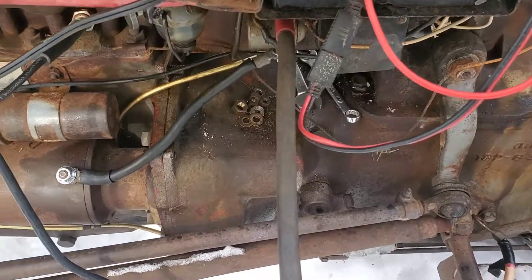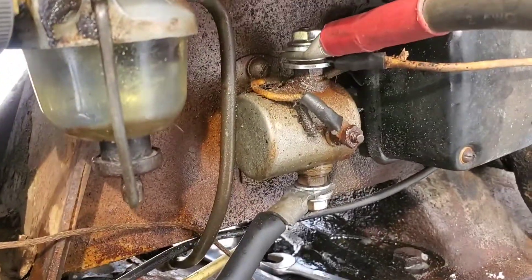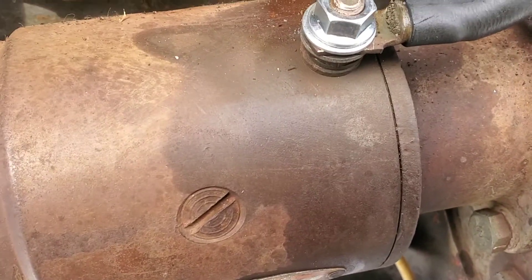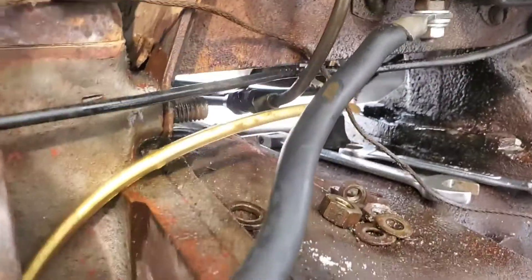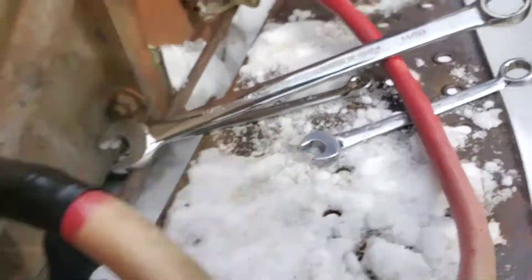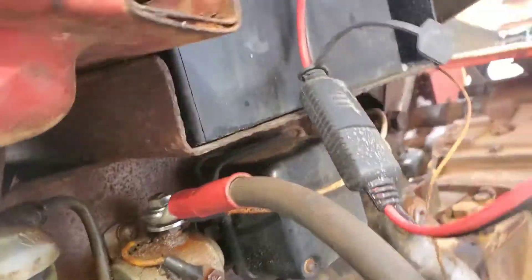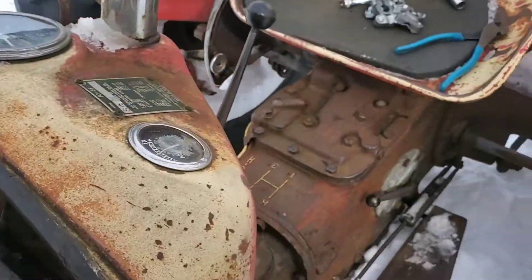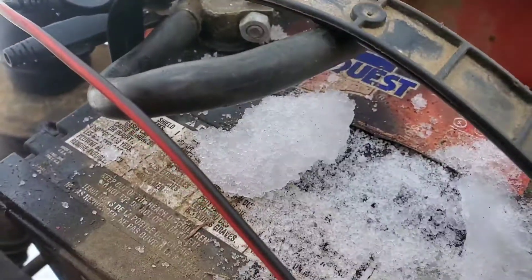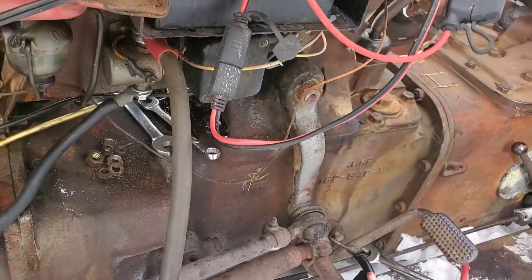All right, friends. So I took everything apart using whatever was still there and tried to put it all back together again, and it just turned into complete junk. So what I had to do was root through all my stuff and try to find some flat washers and some nuts. This cable is complete junk - green on both ends. So I'm making up a new cable right here. This is two-gauge welding cable - it's all I had in stock, but one end was nicely done. I'm going to relocate the ground because it was on the sheet metal dashboard. I don't like it. I don't like why you'd try to pull 350 to 400 amps of cranking power through sheet metal. So it's going on the engine block.